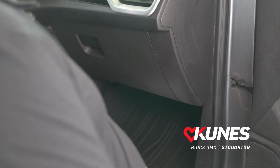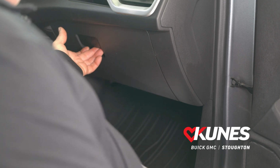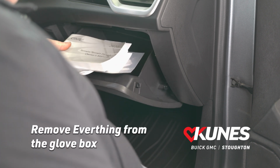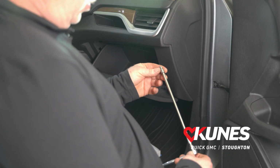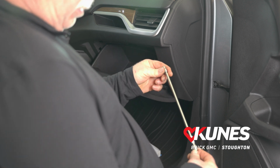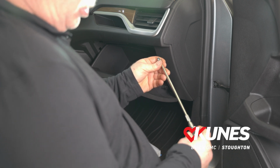To begin with, we're going to go around to the passenger side of the vehicle and we're going to open the glove box. And we're going to take out any loose items that are in the glove box and we're going to set them on the seat. The tools that I would recommend that you use for this job are a 5.5mm socket, a long extension, probably 10 or 12 inches long, 1/4 inch drive, and then also a 1/4 inch drive ratchet.